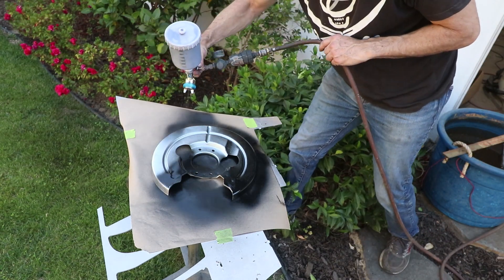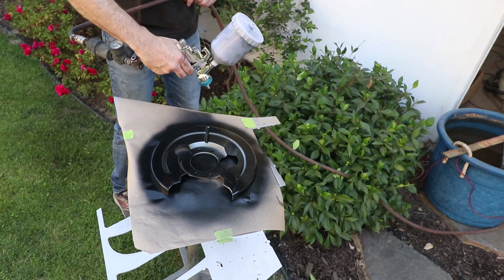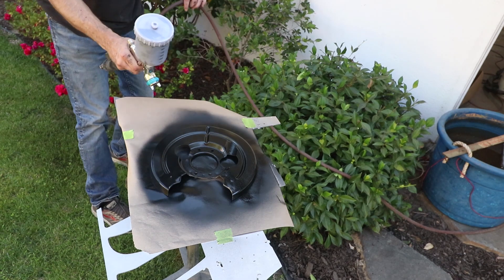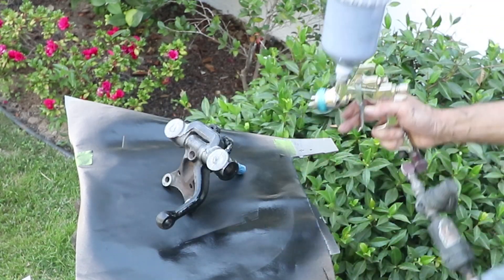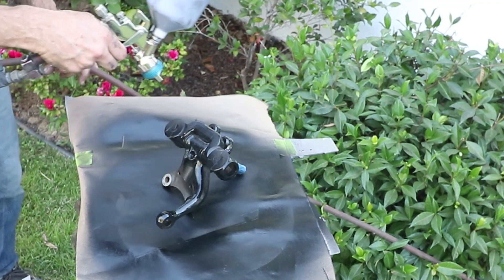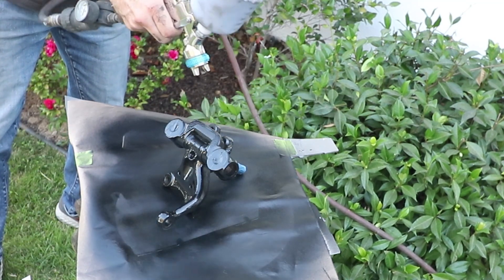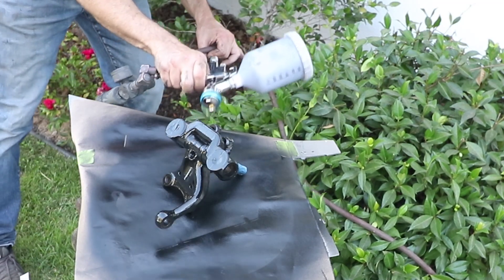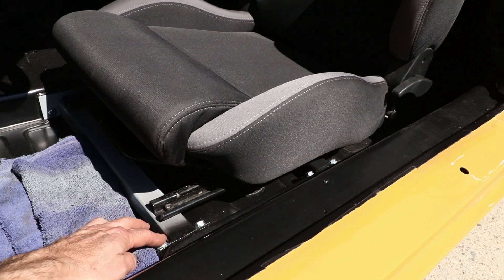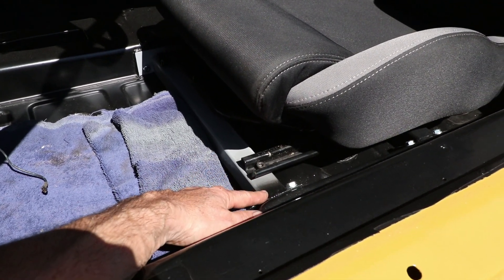Here's that 356 backing plate that I straightened out and welded. And here's another 356 part — this is the whole steering knuckle assembly. I spent a lot of time replacing all the kingpin bushings and linkpin bushings, and fitting the parts to a high tolerance. Another thing to paint is this seat rail down here. These are the FIA-required mounts that go along the front from tunnel to tunnel. It's been epoxy-primered and now I just need to take it out and paint it black.